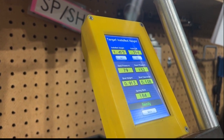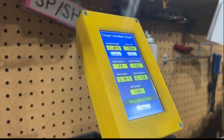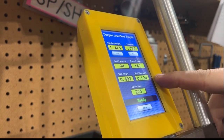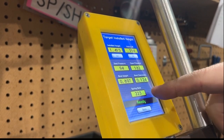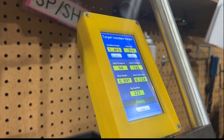Here we have aftermarket C. 94 pounds on the seat — way better. 182 open. We're 124 thousandths away from coil bind. But that spring rate — we're better, but not crazy better. 223 is our spring rate. So you can run a little more RPM.